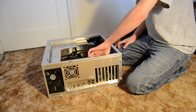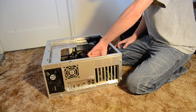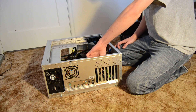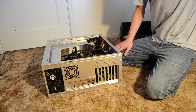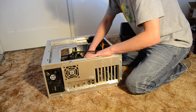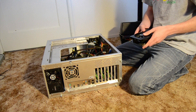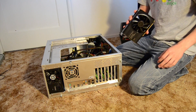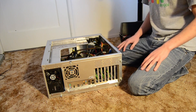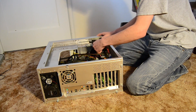What I did was take out every single piece of hardware except for the CPU and kept trying to boot it, and kept getting the fault found error so it wouldn't post. Then I did a visual inspection and found a blown capacitor. I'm going to start taking out all the components because I'll have to remove the motherboard. This is a bit of an older build — I recently upgraded the graphics card. It's an old computer I had that I put some newer parts in for my brother about 8 months ago.